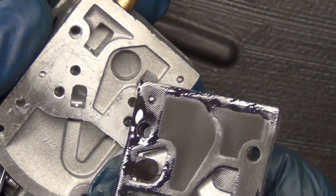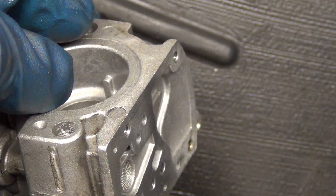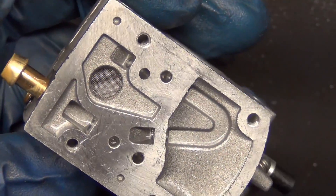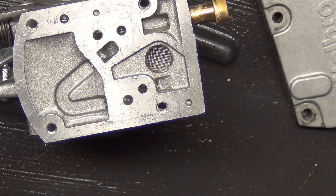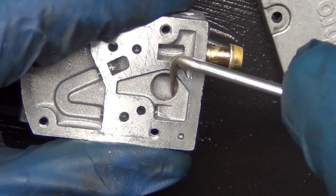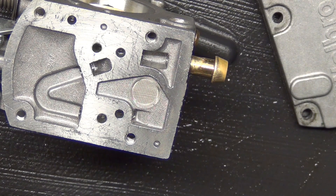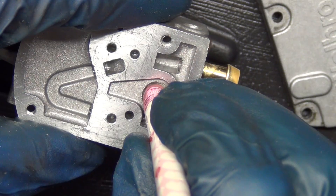So this side's pretty easy. If you look closely at the strainer you can see there's a little bit of debris in there, but not much, so we're going to flush that out. If you don't have an inline fuel filter, you would not leave these in or try to flush them out — you just get rid of it. The key to doing these: you use a small socket. You hook it on one side and pull, or if you can get it to twist up and out. Get your tweezers and just pull it out. Here's the new one — the new one's actually a lot more fine. You can use a pencil eraser or any kind of socket that fits. Make sure you get right in the middle of it and just push it in like that.